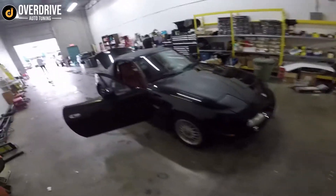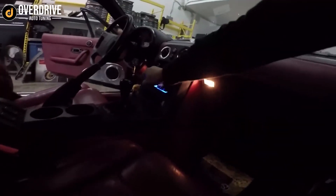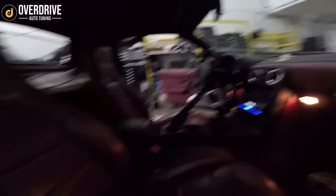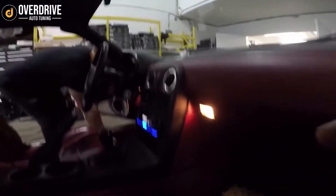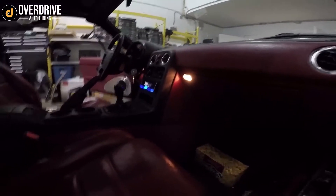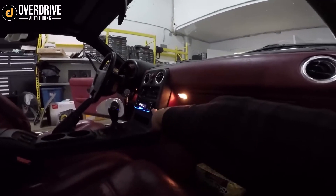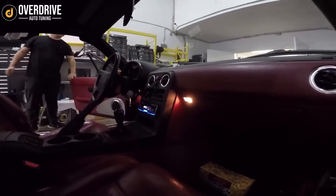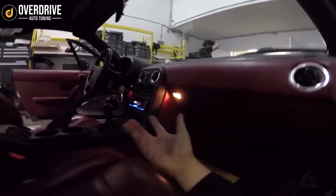This is a 1993 LE edition Miata. The customer wanted a new radio with Bluetooth connectivity. This is the full package with the rear headrest speakers and Bluetooth with the mic up here. The customer was concerned about whether the whole install is reversible because of course it's got collector plates. If you ever want to sell it, the blue LED radio is not going to fly. But no issue — we're using harnesses and there's no cutting of wires, so everything is fully reversible.